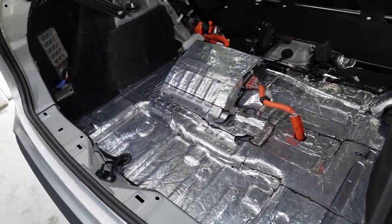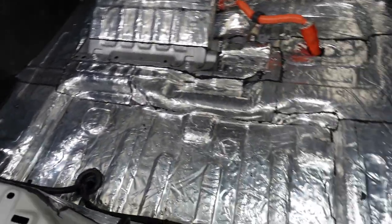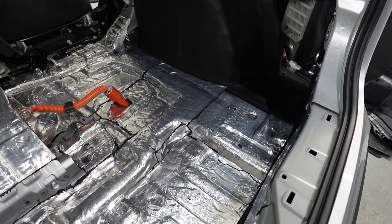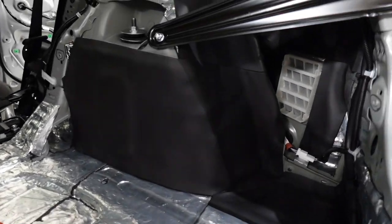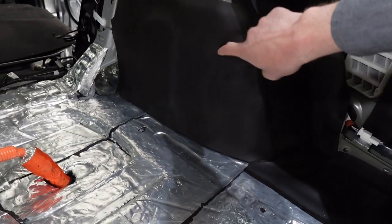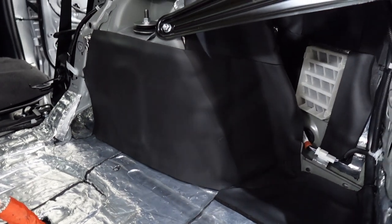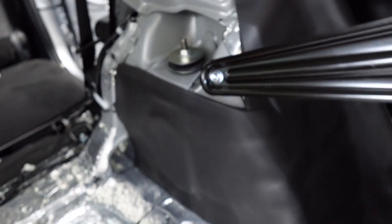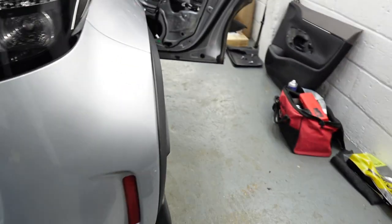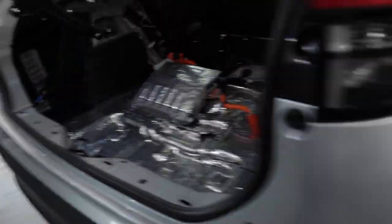This is the boot — hybrid version, hence the battery and all the bright cabling in there. What we've got is 3mm material on top of the metal first, and then we've also got the silver skins on all of this metal around here, and then we put the thermo acoustic liner on top — I think that's five, six, maybe 10mm, it's a bit thicker. We apply that to the wheel arches because, as you can imagine, the wheel arches are a poor area for noise with the wheels directly underneath.